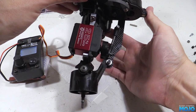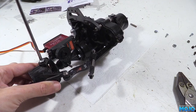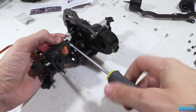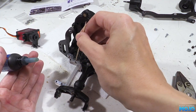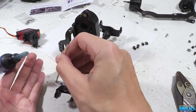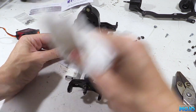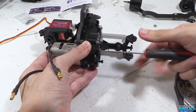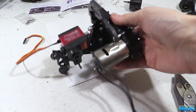So that's the dry build complete. We can take the steering bits off again and do the final assembly. We need to remove the linkage from the servo, remove the knuckles with the carbon link and remove the four screws attaching the servo. Now so the servo doesn't come adrift we're going to use some thread lock in the holes in the mount — they're going to be really difficult to get at once the axle's back on the chassis. Just as before, a tiny amount of thread lock and wipe off the excess. Then we reattach the servo. Next the motor goes back on with its plate, metal tubes and two screws, nip them up and that's the axle ready to go back onto the chassis.